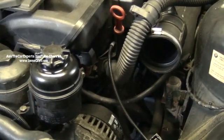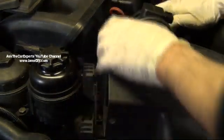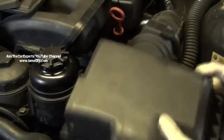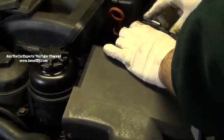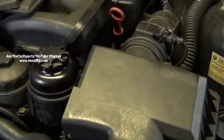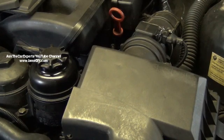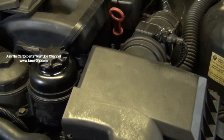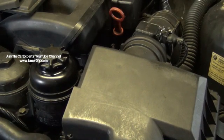The airbox goes underneath in a specific spot. Don't forget to tighten down the clamp that you loosened. Then install your snorkel. Clear your fault code and you should be good to go. Make sure to start the engine two times — after you clear the code, the first start doesn't necessarily trigger a check engine light if you still have a problem. On the second start is when your check engine light will come on. If it does come back on, you might have a problem with your engine control unit, your Vanos unit, or the pickup, which will be more involved. I will be making a video on the Vanos on an M52TU and M54. Thanks for watching, everybody.